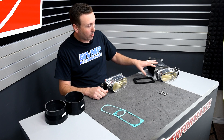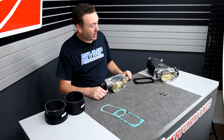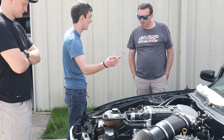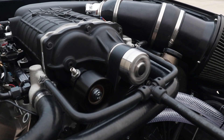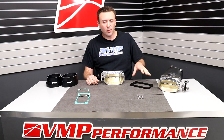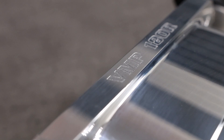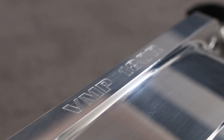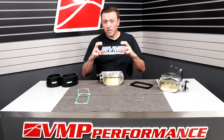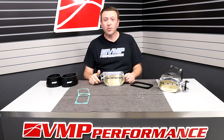Over here I have some older parts. This is our Terminator GT500 bolt pattern single blade monoblade throttle body. A lot of people were using this — like Cody Chaney has one on his Gen 3R just to get him off and running. This is a really nice setup for the smaller 4.6 Cobra engines that don't move as much air. The big 5.4, 5.8, even the 5.0 Coyote needs all the air in the world. When we designed the Gen 3R two or three years ago, I made the opening size really really big with the intention of doing a larger throttle body in the future — and that future is today.